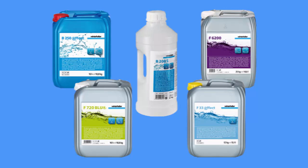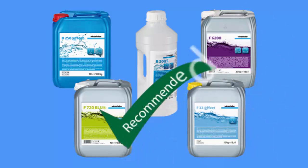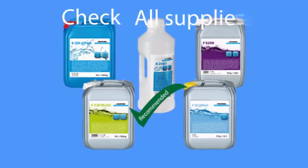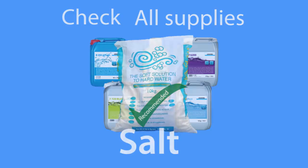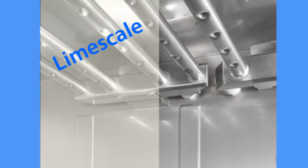Ensure that all supplies are properly filled, and always use the best chemicals as recommended by the manufacturer. Make sure that all levels, including the salt for softening the water, are properly filled. If you see that your dishwasher has a cloudy off-white coating, this means that hard water is leaving limescale on the inside, which coats and damages the heating element.